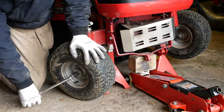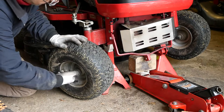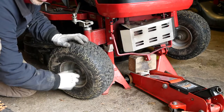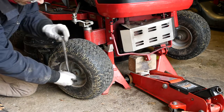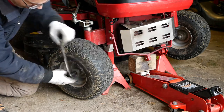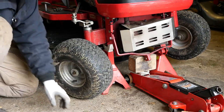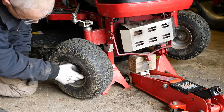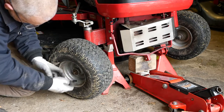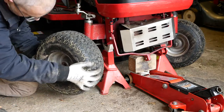So that's a 19mm. You might notice if you've got an eagle eye that this is a nylock nut that's on the wrong way around. Not my work. Still works, I guess. I suspect those washers might be on the wrong way around as well. Anyway.